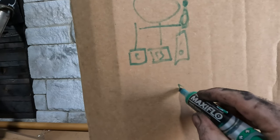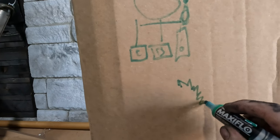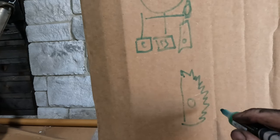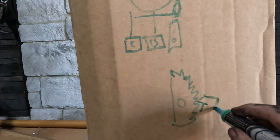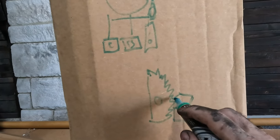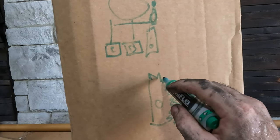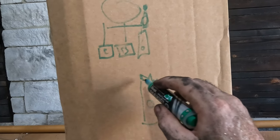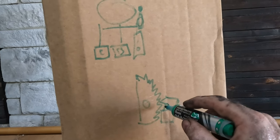If you actually look at the quadrant, the factory one, it's got all these teeth and it's like a semi moon like this. And there's another little bracket like this that's sitting down here. So this guy engages in these teeth and it clicks. And that's how, as your cable stretches, this is gonna move and click and lock itself into place where it needs to be. And this actually works really, really well when they work.